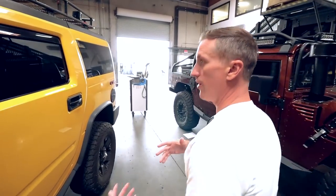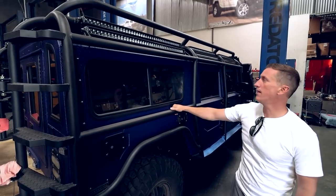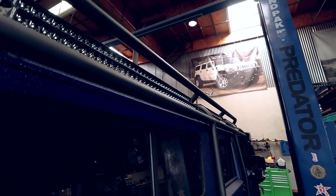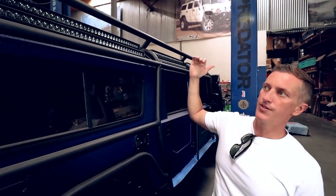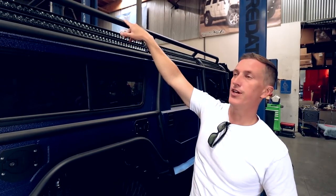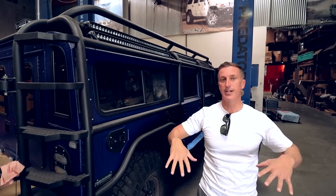Here's another design. Now it's not on a traditional roof rack, but we integrated a roof rack into the exoskeleton design. This is our search and rescue 10-foot roof rack integrated into this exoskeleton design — nice and tight, maybe a solid quarter inch or so off the body. We have the roof rack design mounted up here. We're able to mount lights off the lower bar here as well as the roof rack bar up here, which is also part of that exoskeleton. This one's a little bit different because the decking is all thick quarter-inch aluminum plates that are bolted down. You can see that design has a cross, triangulated pattern across the whole entire roof rack, with aluminum plates that fill that in.